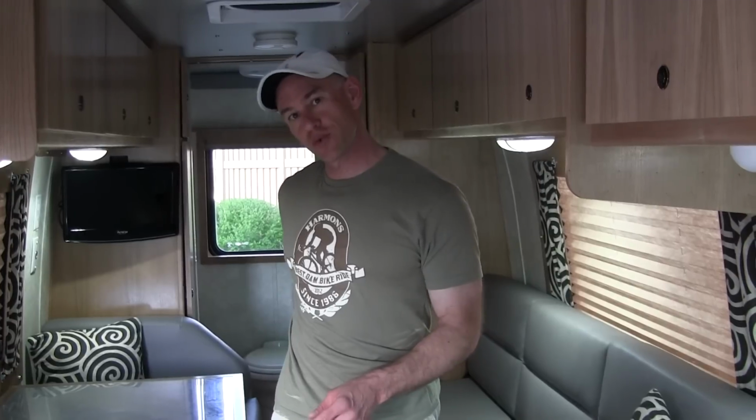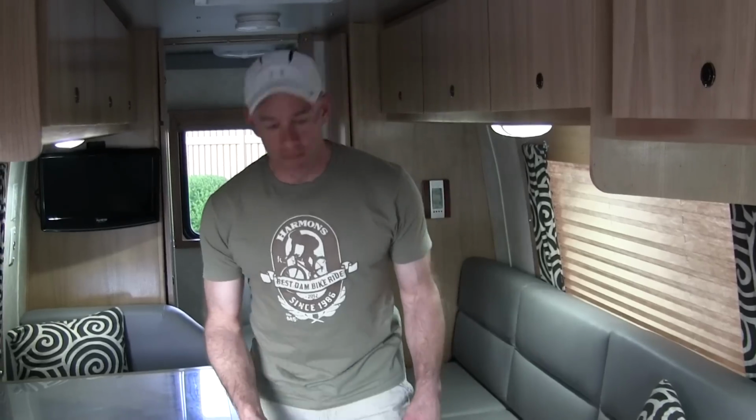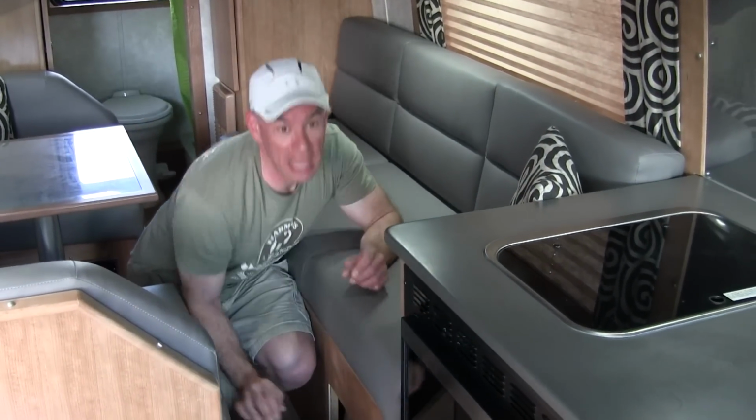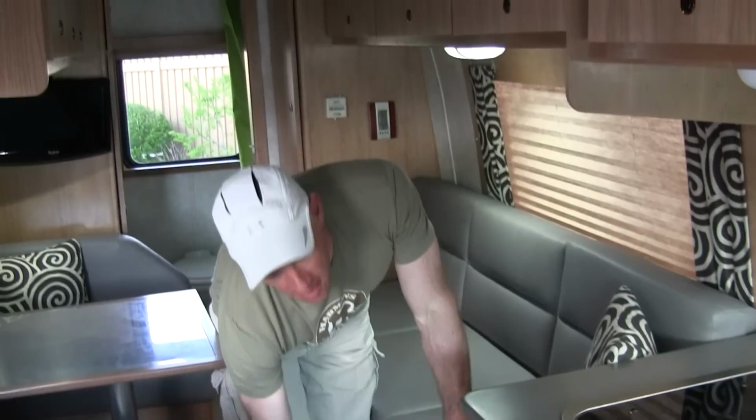And the freshwater tank is also finished draining. So I've shut the freshwater tank valve, and now I'm going to engage the water heater bypass. Now a lot of people would use the bypass to avoid pumping a lot of antifreeze into their hot water heater. We're not going to use the antifreeze, but I'm still going to engage the bypass so that I'm not blowing air into the hot water heater. All right. And done. Now to the compressor.